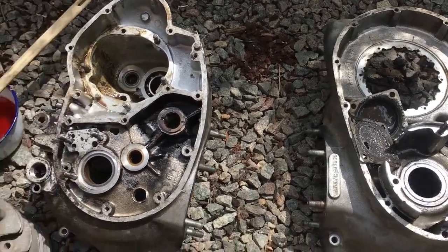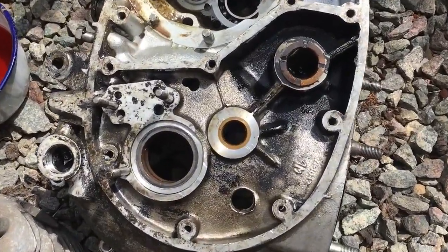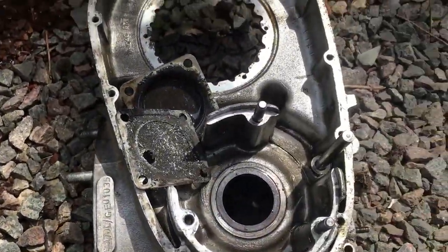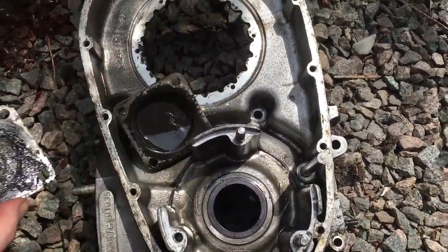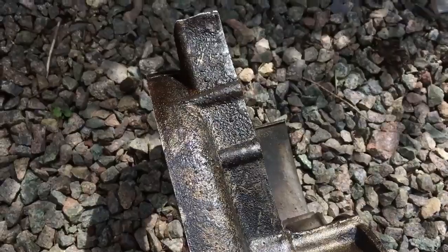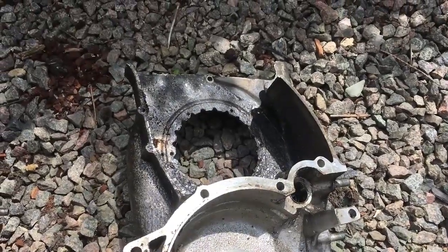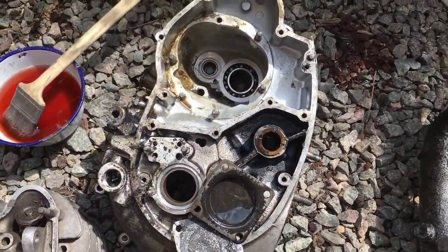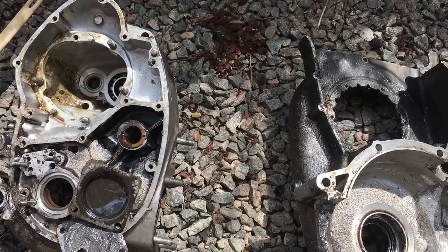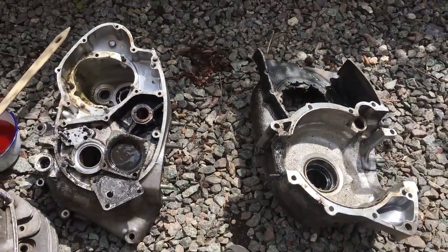Let's get cracking with cleaning these up — there's the before picture and we'll see what they look like after. You can see all the black coating everywhere, and look, it's just covered everywhere because it was leaking. As you know, we found there was no gasket on the primary case, but there was luckily still a bit of oil in it — because if the slipper tensioner shreds dry, which it can do, then the chain can jump. I've experienced that in my youth before I got to know these engines.